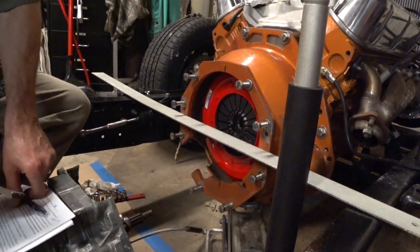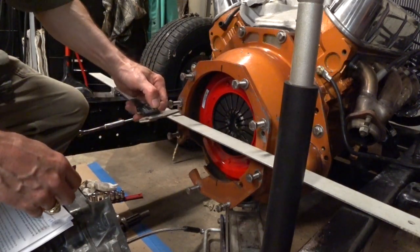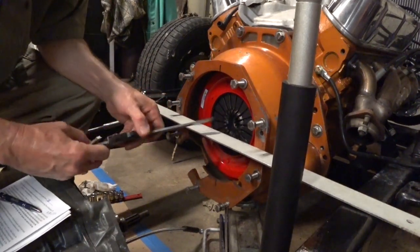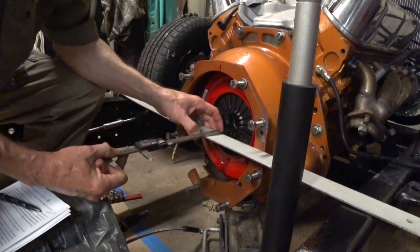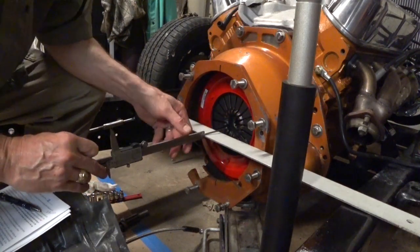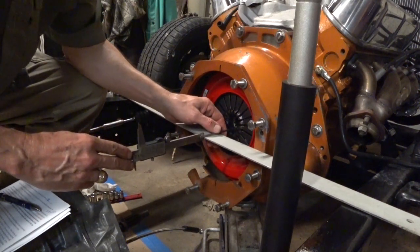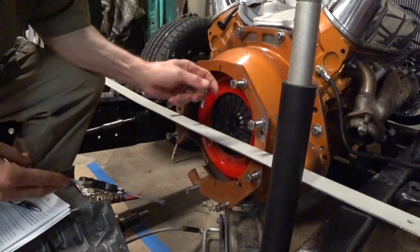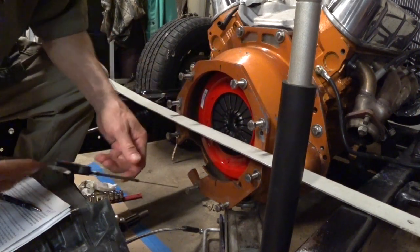One thing you can do is use an ultra cheap Harbor Freight 8-inch micrometer of sorts. I don't really consider it a micrometer, but it does measure reasonably accurately. So if we push this out, we contact it against one of the teeth, then we can set this distance and just use our finger to line up on the straight edge. Problem is, it's a bit inaccurate, so what I've been doing is putting this all the way against the face of the rule, and then just catching the tooth, maxing it out. Now, the proper measurement would be to subtract this. But since we're looking for a difference between the two dimensions, it really doesn't matter if this is included. So I'm going to go ahead and include this in the measurement.